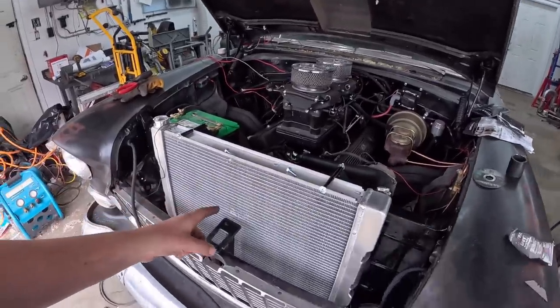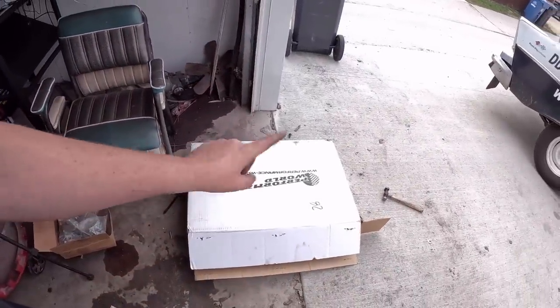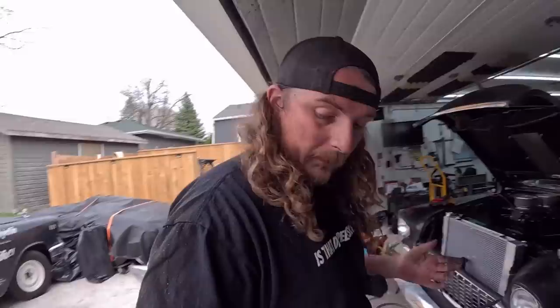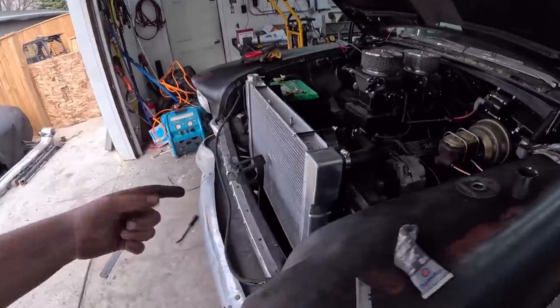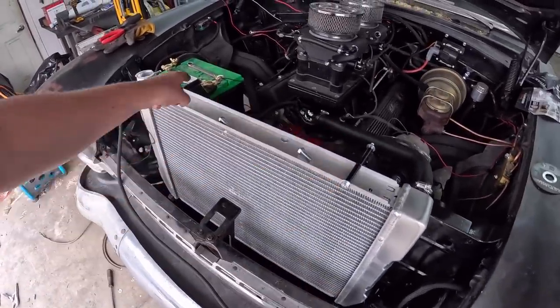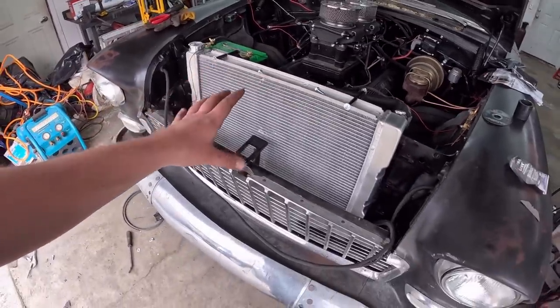This radiator, I gotta say, from Performance World, this is a great Canadian tip if you're Canadian. I think they're $300, $350. I don't know what the part number was, 3017 or 8017 or something like that. It's the biggest universal radiator. I welded in a little plate across, especially if you're a Tri-5 guy, plate across, a couple of these little tabs, holds it perfect, and that's a big honkin' rad.